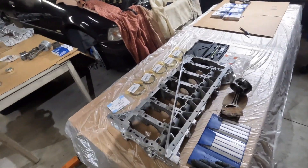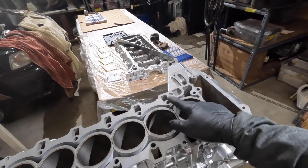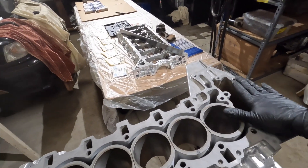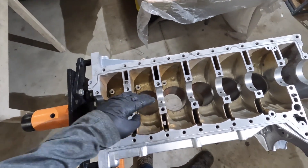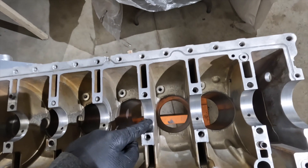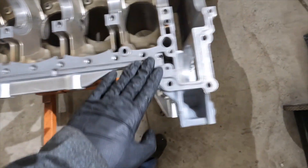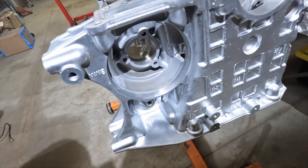The bed plate has been cleaned and painted. Bores have been honed and measured very in depth — one, two, three — we've measured the bores. The deck of the block has been stoned just to remove any surface imperfections, no material removal, just surface prep. The bottom has been cleaned, main journal bores cleaned, spray nozzles removed, and air has been blown out through each of the main bearing journal supply holes as well as the piston spray nozzle holes to make sure there are no obstructions. Everything is cleaned; the bed plate has been thoroughly cleaned of old sealant. This block is prepped and ready for build.